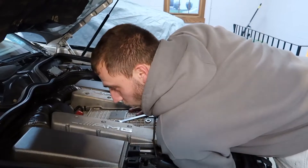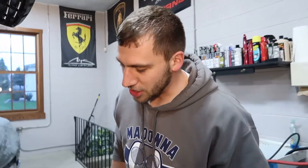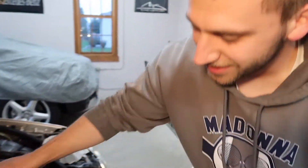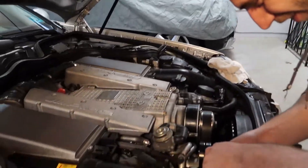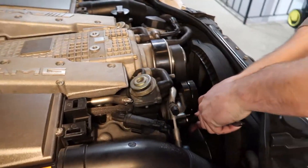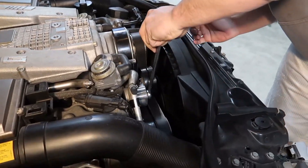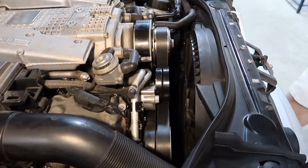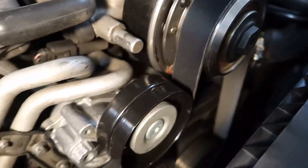This only took us about 20 minutes. So the belt side gets lined up and now it's time to take this pin out and release the tension. How's she look? It looks pretty good. I'm going to inspect it real fast before we start it up or anything. Like Matt said at the beginning of the video, we haven't done the serpentine belt yet because we want to get that oil cleaned up off of it. Everything feels good. The belt feels pretty snug.